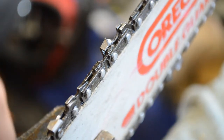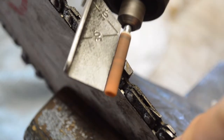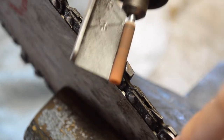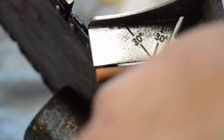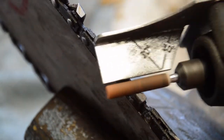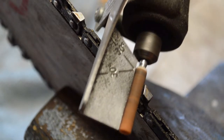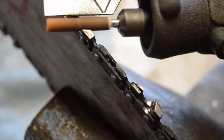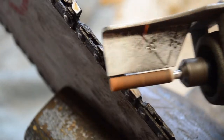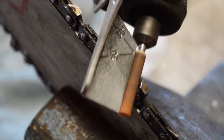This chain's got a little life left in it. If you notice on the front side where I'm grinding — on the front side of that is an anti-kickback dog, and in case it digs in too far and gets a bite, it'll make that saw jump out of the wood and it could get you. I've taken and ground some of them off — not on this saw, I've got another bigger one — and it's got a wrist brake on it to stop the chain. When you take them off, it takes off shavings like nobody's business and it'll flat go through a log, but for safety's sake we leave most of them on there.